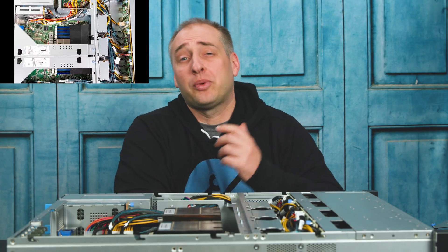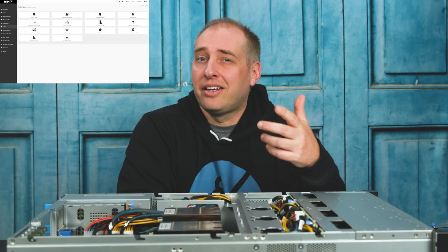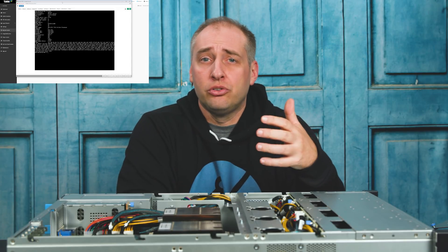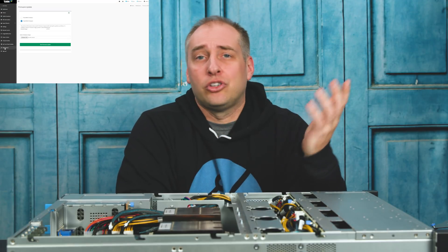In terms of management, they're using the MegaRAC SPX solution, which means you get an HTML5 iKVM, Redfish, and a whole bunch of features for managing the system out of band. One cool thing Tyan does is not charge you for that iKVM functionality — you can get it without paying an upgrade fee like you would with HP iLO, Dell iDRAC, or Lenovo XClarity. Tyan also lets you upgrade the BIOS directly from the web interface, so you don't need an extra license fee like the roughly $20 Supermicro charges for their solution. It's not a huge dollar amount, but it's a nice advantage with the Tyan system versus some other options in the market.